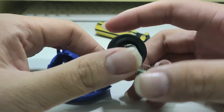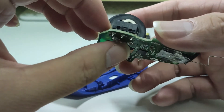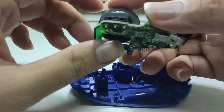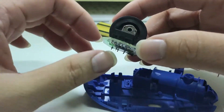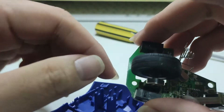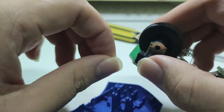After removing the circuit board from the body, the scroller is very smooth. I suspect there may be a bend in my circuit board that is causing the scroller to sit nearer towards the bridge after a few years of usage. My plan is to raise it up a little bit. I noticed there is a contact point to a hole, so I'm thinking we can put a thin layer of tape to cover it, giving a few millimeters of raise to the circuit board. Let's cut a little bit of paper tape and tape it on this contact point.